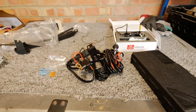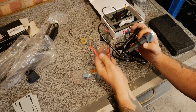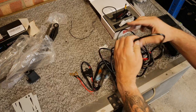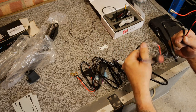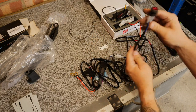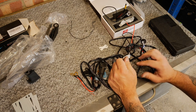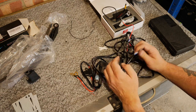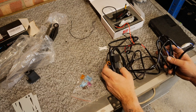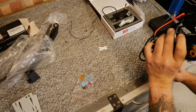Next job, let's have a look at this loom for the light bar. This is fairly straightforward: one end goes to the battery and has the relay, that's just positive and negative. The other end splits into two — one goes to the light and the other to a switch on the dashboard. It's actually got two cables so you could do two spotlights, but we've just got one. The switch has got a light on it as well. I'll put a link to this or something similar in the description because you really need a relay switch if you've got a light bar.